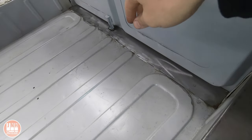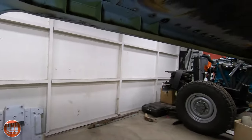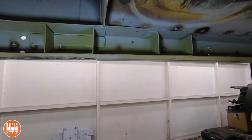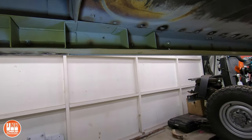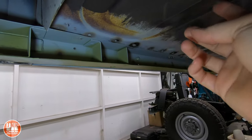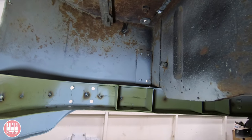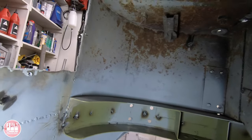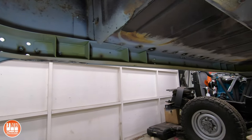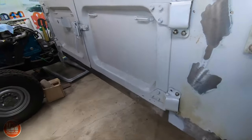I'm very happy with how this came out. I still have some more cleaning to do, especially on the underside here where you can see the welds have come through, so I'm gonna clean all of that and do a little bit more welding under there. Then I'll clean it up and eventually coat it all with POR-15 just like I did the rest of the bottom. I'm also gonna put some seam sealer around the edges to hopefully prevent it from rusting again. I did use weld-through primer on all the surfaces I can no longer get to, so hopefully that's gonna be good enough.